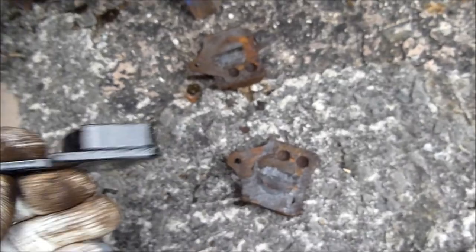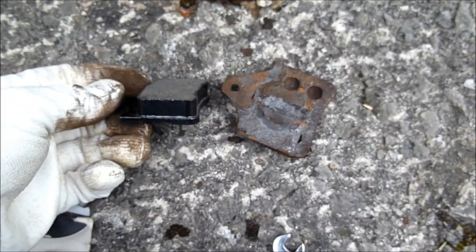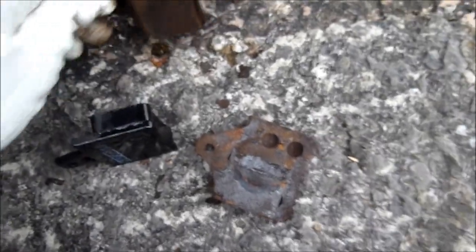Some brake cleaner. And I'll also clean the pins up in the spring and put plenty of copper slick on. And compare the new pads to the old — there's quite a difference there. Here's the old one, there's a bit of a difference. I want to take them out just to clean them up really, so I might as well change them at the same time. It's not worth messing about for how much the pads cost.